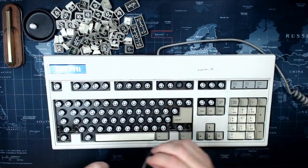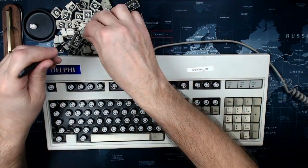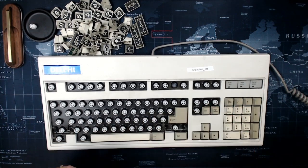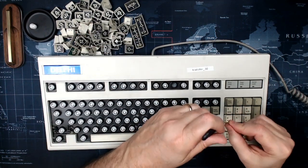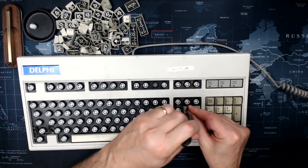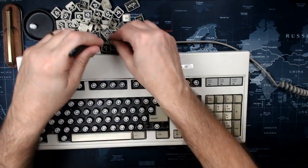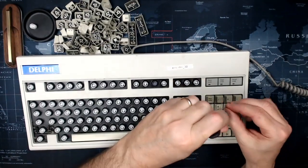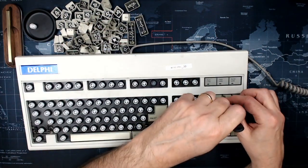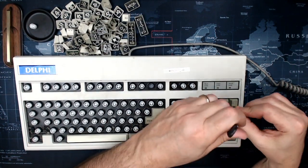Part of it, I claim, isn't my fault because keyboards are 30 years old. The keycaps and things will go forever, and the switches, but the sliders, there's often just this little tiny piece of plastic holding it there, and after 30 years, those things break on me, I don't know, 60-70% of the time. They rarely survive me taking the keycaps off, not that I'm the most gentle, but the most fragile part of a 30-year-old board is this little part that holds the sliders, or the stabilizer's bar in place.